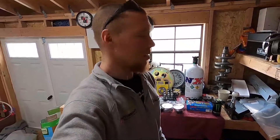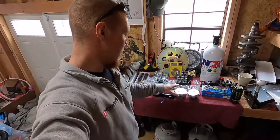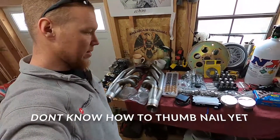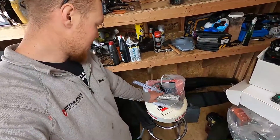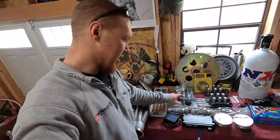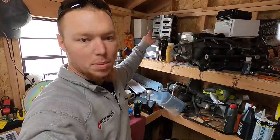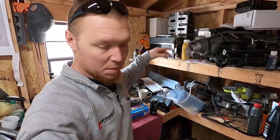Quick update today on project musket ball. We've got a table to clean off here — I did a little thumbnail deal so got all the counter space taken up. We've got to get a lot of this cleaned out and put away today. Going on as far as cleaning up the heads, getting the new valve springs installed — they are Trick Flow Specialties 660 springs. I got titanium retainers, and we'll be taking these heads apart, getting them cleaned up, getting them filed up, and then putting the springs on.